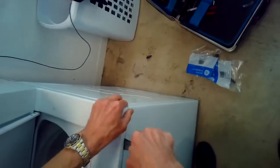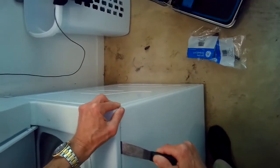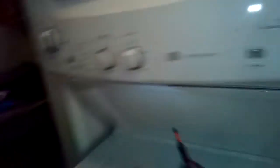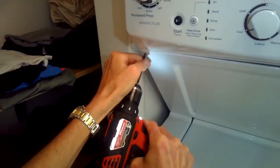The whole basket seems to be off kilter, so we're going to unplug it or turn off the breaker so there's no power going to it. We're going to take off this front panel. To do that there are some clips that we have to disconnect, and we're also going to take off this upper panel, so we'll take out a couple of Phillips head screws.